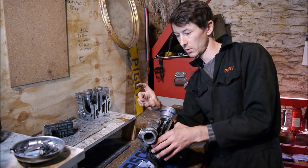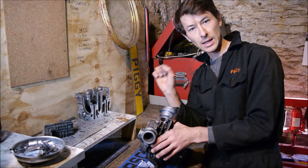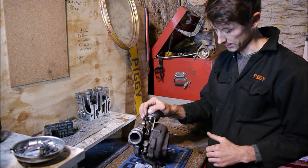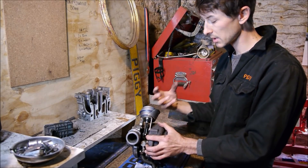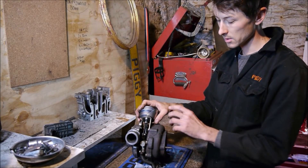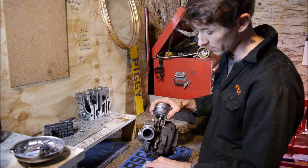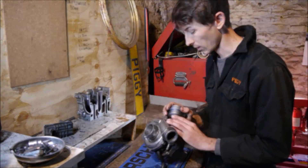If you've ever looked at the solenoids in your engine bay that control a modern turbocharged car — a little solenoid with a couple of pipes and an electrical plug — it's also the thing that controls your EGR. Basically the same system, just does different things. It's quite tricky to control these correctly so that EGTs and EMPs aren't high when cruising and you're not getting boost spikes. It takes fine-tuning to get these right, and ECUs these days make that a lot easier. These run in a bit of a sweet spot, which is why controlling them is tricky, but if you manage it they are incredible.